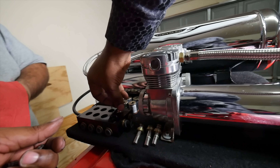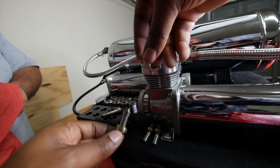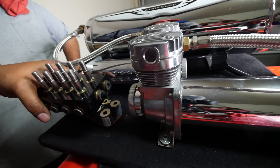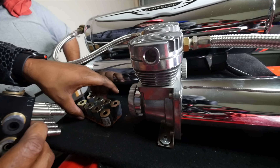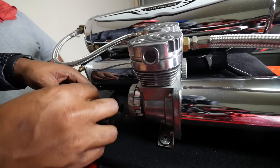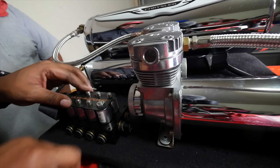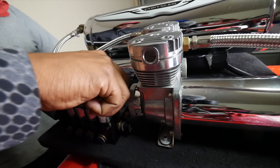And then you repeat the process. All right guys, we've finished all the connections — they're hand tight. As y'all can see, notice versus the old ones: the springs are really jumpy and the other ones were stiff. So hopefully that will help it lift better. This goes back on top, you gotta get it in the hole just like that, flip it back over, then you take your actual bolts and put them back on top and use a 14 millimeter — and you tighten them up. Really simple to rebuild these.